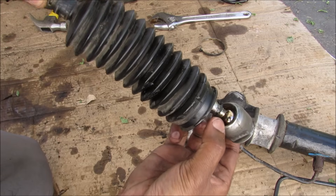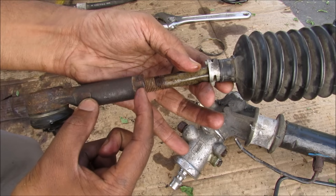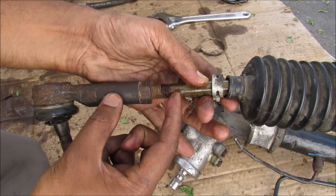The inner and outer tie rod assembly has what looks like a forged piece laminated over a ball stud, with a long shaft that leads to threads where a jam nut sits. This will control the toe-in and toe-out alignment.